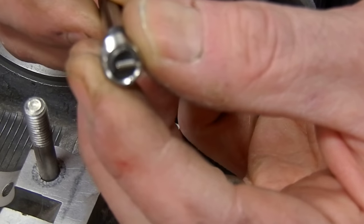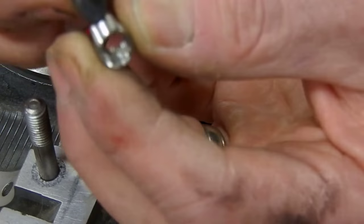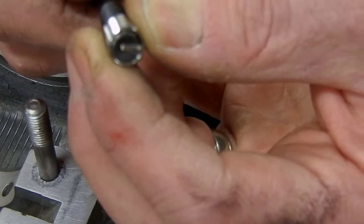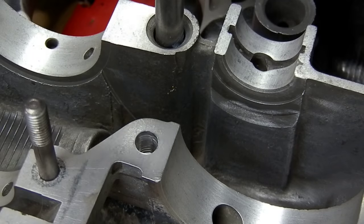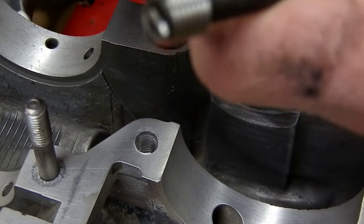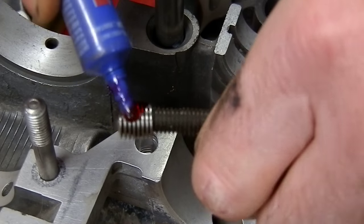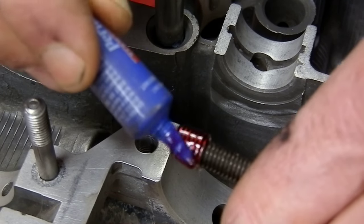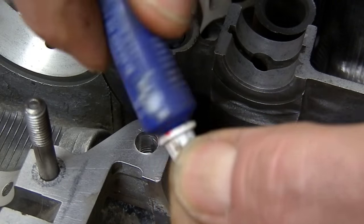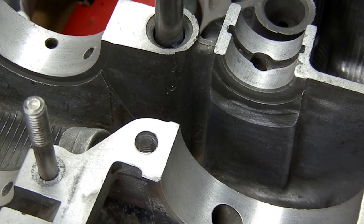You can see there's a drive on the end of the tool, and when you thread this into the helicoil it grabs the edge of the helicoil and then you can thread it into the bore. What I like to do prior to this is take my red Loctite and flood the helicoil and the tool with red Loctite and just let it soak - it's almost like marinating something, getting it ready to go into the hole. I'm just going to leave that out of sight for a moment and let it sit.